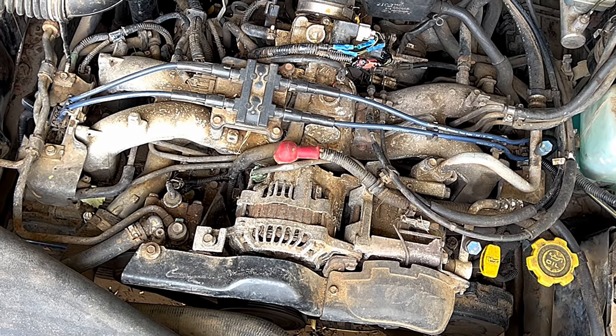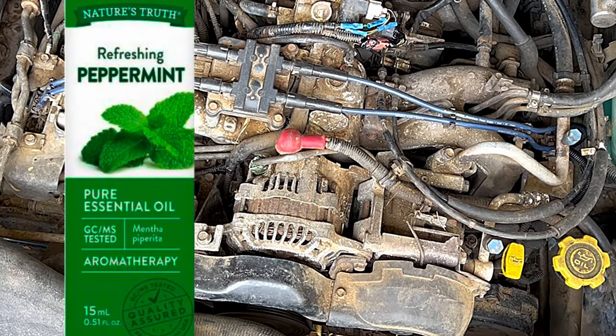We had to leave this parked for a little while longer. I looked around and did some more research and it turns out peppermint oil is the way to go. The main bad move on my part when we left for a seven-month road trip was thinking that the rodent deterrents would work. They did work, but over the course of seven months the smells wear off — it needs to be refreshed. So when we left the vehicle again for another five or six months, we did the peppermint oil, which everyone will tell you is the best way to go. I set up a spray bottle and cracked the hood a little bit so it wasn't as cozy a spot for the rats to hang out in. A good buddy of mine is going to come by every week or so and re-spray the peppermint oil all up in the mix.